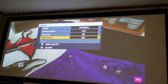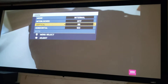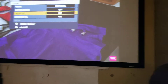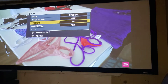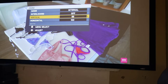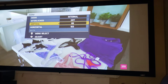Then I'm going to come back to the vertical and fill it all the way back up. So basically on this screen at basic 16:9 I should have a little bit of overscan — I can do 104 to 106 inches. Being able to get inside and do the internal zoom and adjust the vertical and horizontal pixels makes a big difference — it lets you fill up a wider screen and make more of an ultra-widescreen.